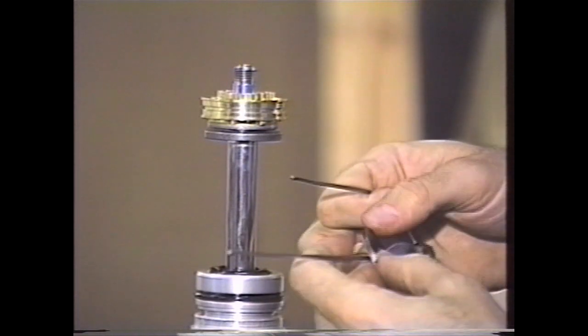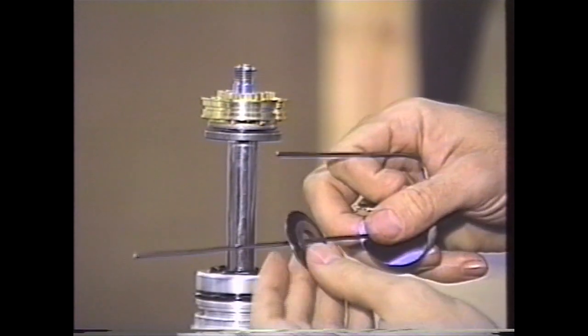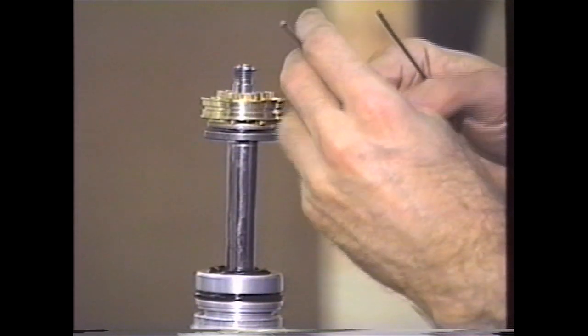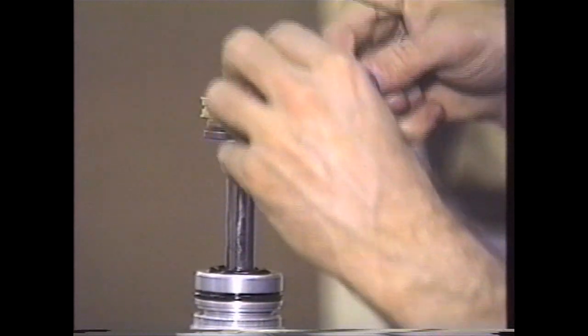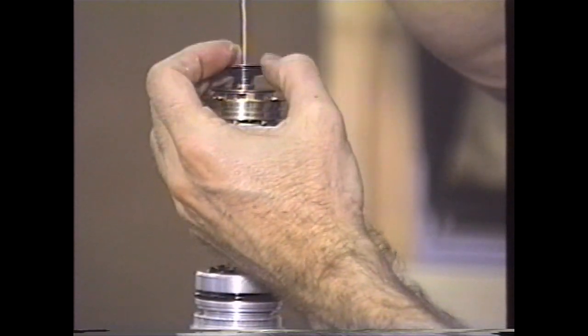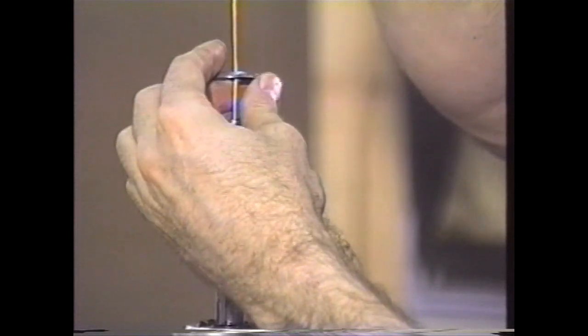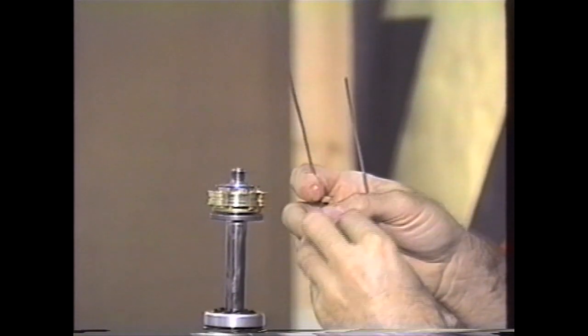I've already selected a low-speed and a high-speed rebound stack — this being the low-speed stack, and this tapered stack being the high-speed stack. The large diameter shim on the low-speed stack goes against the piston face, and you make sure that it covers the entire port. On this model, it is lining up to about the perfect height.